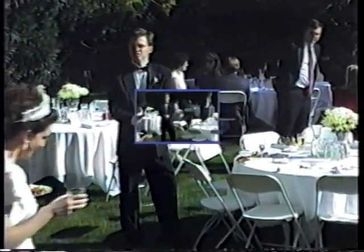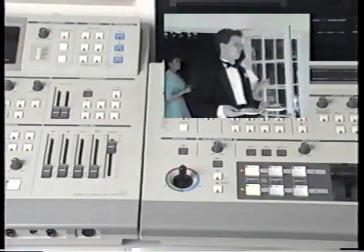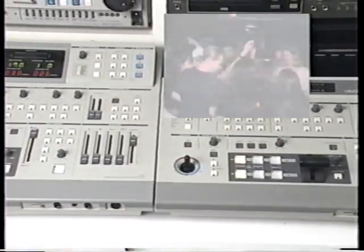The MX-30 does not have the MX-50's true compression capabilities, therefore the fly-on type effects are not possible, and absent on the 30 is the transition speed and wipe pattern display window. Though the overall resolution and quality of the video signals emitting from the MX-30 are not as high as the MX-50, the 30 is a substantial jump up from the AVE-5 and MX-12.